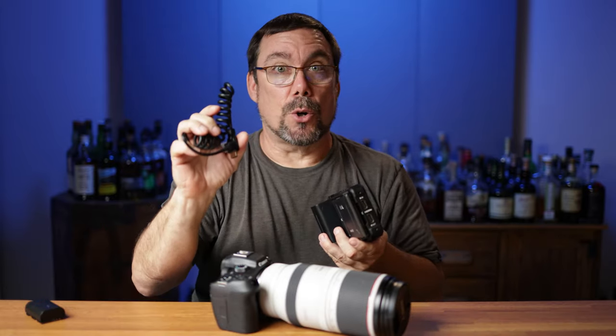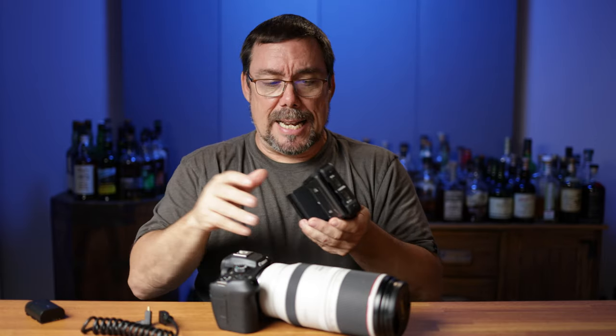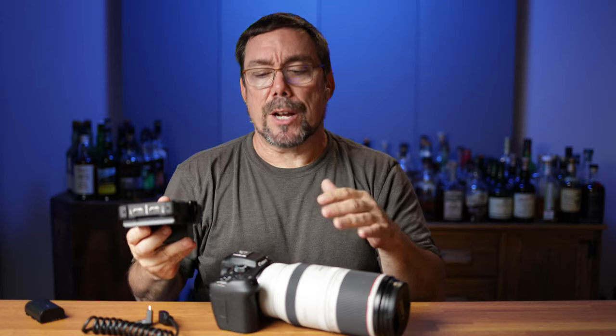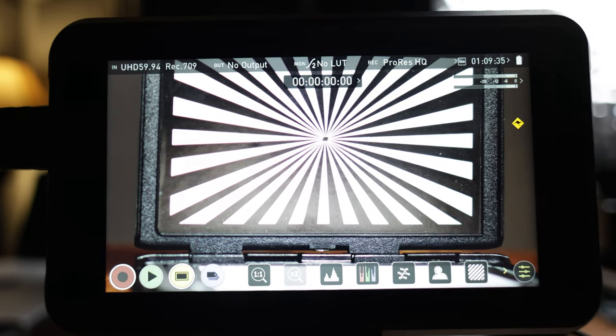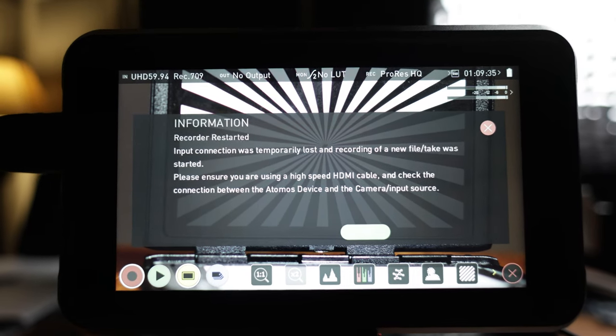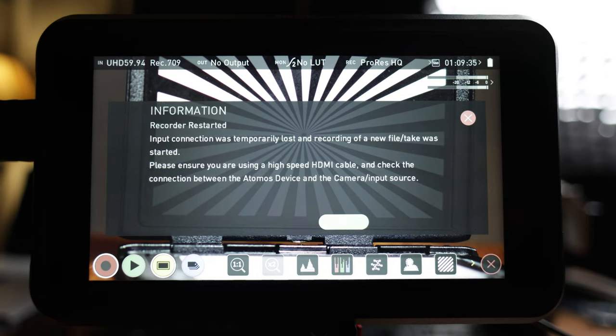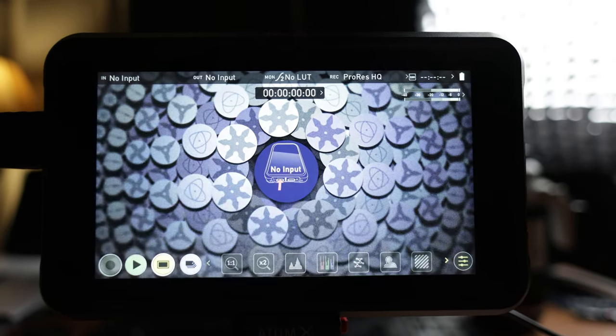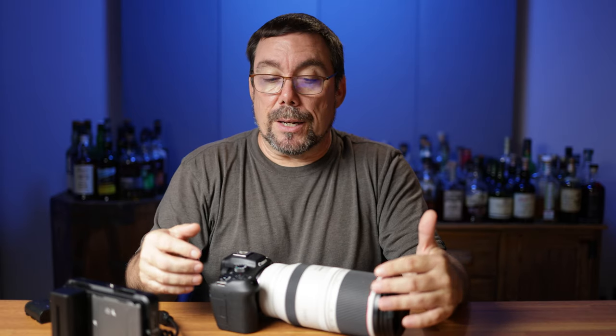Now let's move on to the micro HDMI cable issue. While I was doing all of my heat testing, I had the Atomos Ninja V hooked up with the Atomos Ninja cord. I shot my first couple of heat tests and never unhooked the cables — the Atomos recorded no problem. I recorded internally on the camera while also capturing the screen on the Atomos. Then a couple of days later I turned the camera back on without unhooking anything and started another heat test — and I started getting screen flickering, starting and stopping. That yellow warning triangle symbol popped up, and the Ninja showed a warning saying it had stopped recording, to check the connection, and make sure I had a 2.0 HDMI cable.